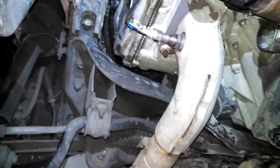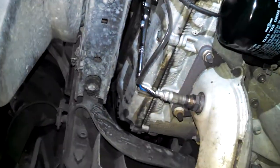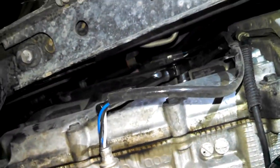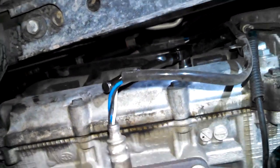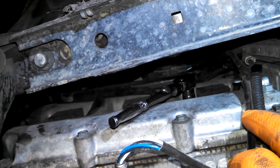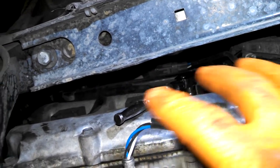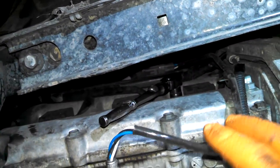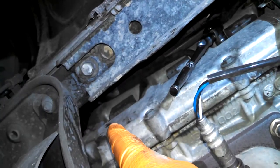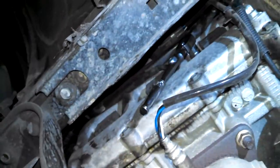All right, 2004 Subaru Outback H6, six-cylinder engine. There are a couple of ways to do the spark plugs, as I've seen on YouTube. We can go from below. This is an example here. We've got a quarter-inch ratchet and a 12-millimeter socket to take the bolts out of the spark plug coil here. There are three coils on each side, of course. There's about 2 1/4 to 2 inches of gap on both sides.